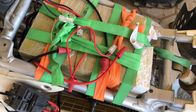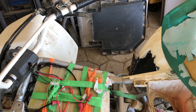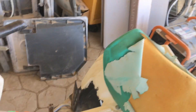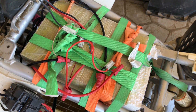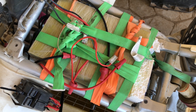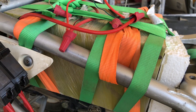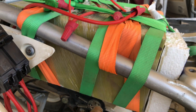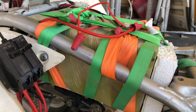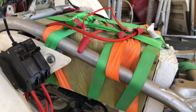These batteries have a tendency to overheat. Right now it's probably 108 degrees out here in the desert — we live out here and it gets very hot. I can't even run this thing midday; I start it up once or twice and by then the batteries are already too warm. If I split them apart they would cool a little bit better, but it's still just not enough to air cool them. There are battery cooling systems but I don't want to get into that with this quad — it's just way over complicated.